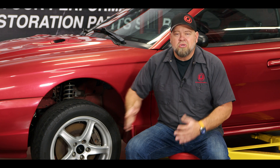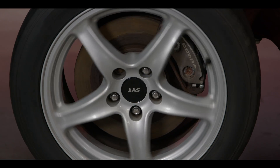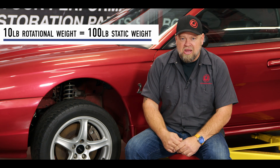When deciding where to start shaving weight — sprung or unsprung — the answer is honestly both, because the best place to start is anything that rotates. Rotational mass requires additional energy for both acceleration and deceleration, while static mass is simply along for the ride. On average, 10 pounds of rotational weight is equivalent to 100 pounds of static weight. So start with the things that move: wheels and tires, brakes, engine pulleys, flywheels, lightweight clutches, lightweight driveshafts, and as you get more serious, axles and carriers. Rotational mass is the best place to start, and that's where all the high-end components are on race cars.